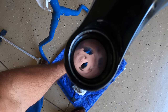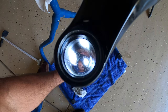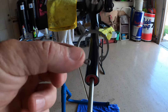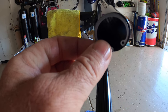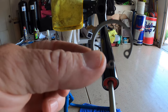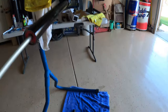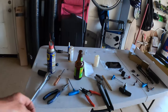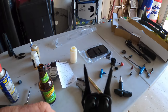This is inside of the leg — actually looks pretty clean, no damage. One thing I skipped — I didn't show you guys because I was a little bit frustrated — this clip does go inside here, so I just pulled that out, similar to this right here, using the proper tool. Once I pulled this out, that bottom shaft comes out — you can see it laying there on the ground — using this tool right here.